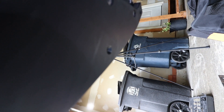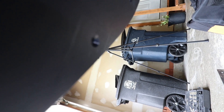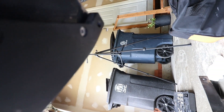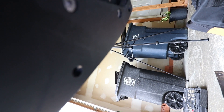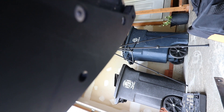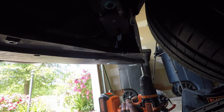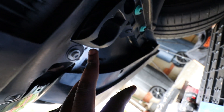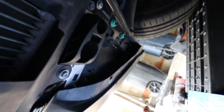As you can see, these are the screws lined up and how I secure them — this is exactly how it needs to be done. It just takes a little bit of time and patience but eventually you will get there. The final step is to install the self-tapping screws onto these two holes — one right here and the last one that is open right there — which will secure the lip on those two ends. You just drill a self-tapping hole there and it will stay in place, same thing on the other side. After complete installation, this is how the bottom should look. You have all the screws lined up, so now you can go ahead and put back the wind deflector tray and the job is done.